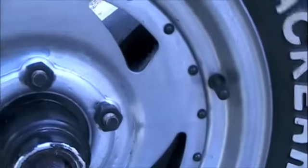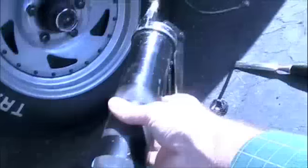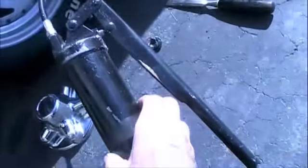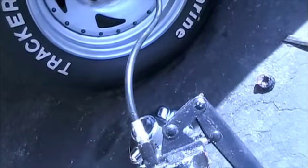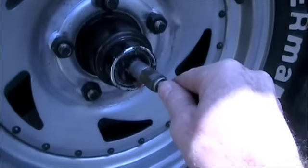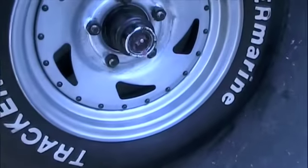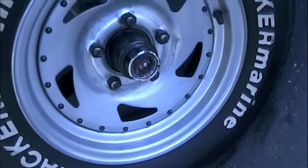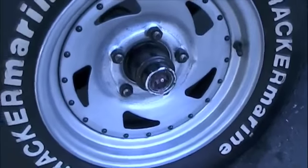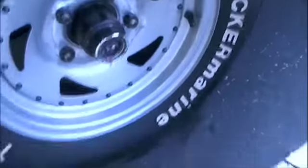Right here's your grease fitting. Take a cheap grease gun like this one right here — a hand gun. You can get them at Walmart; they're not very expensive. Just plug the end right on the fitting and push it on. Then take your hand and pump some grease in there until it starts popping out, which forces any water that's trapped in there out and keeps your wheel bearings in good shape. That's one thing to check.